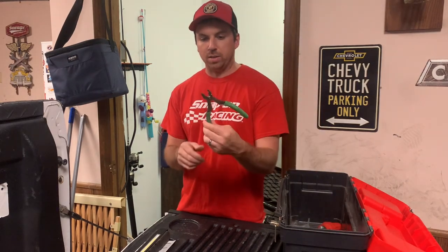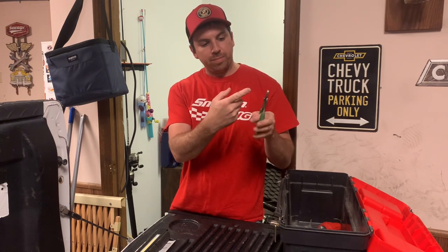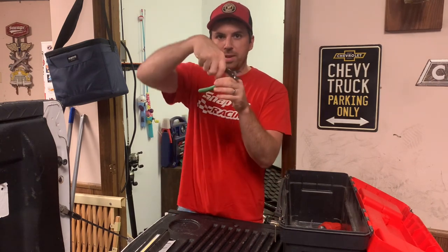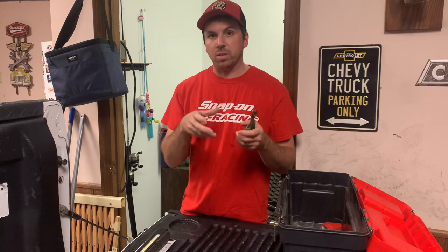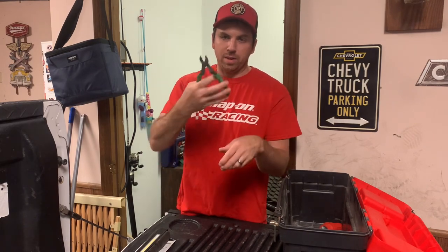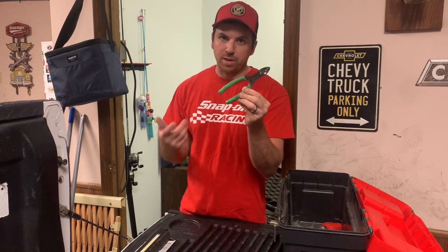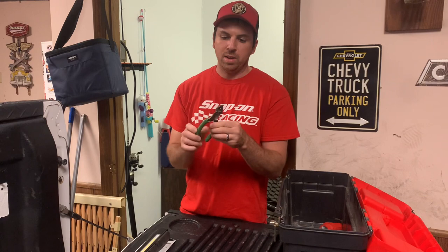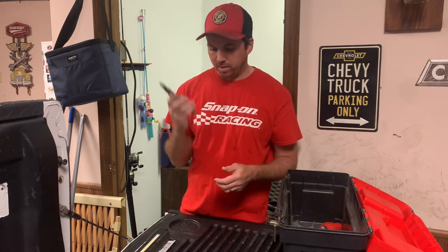I also got some pliers off the Snap-on truck. I got some strippers and crimpers — just this little guy for getting into tight spaces. I've got a regular Blue Point stripper and crimper, but on that one the crimpers are in the handle and the strippers are up top, so getting into tight spaces — like when you've got a bundle of wires putting them all together or putting in a pigtail — it's hard to swing it through to crimp. So I wanted something where the crimpers were at the top. Basically I've been using the Blue Point strippers to get everything going and then using these to crimp my connectors. I use insulated heat shrink connectors, not just regular butt connectors. The part number is PWC SS7ACF. So far so good — I like them, they're not too bulky and they're getting into tight spaces.